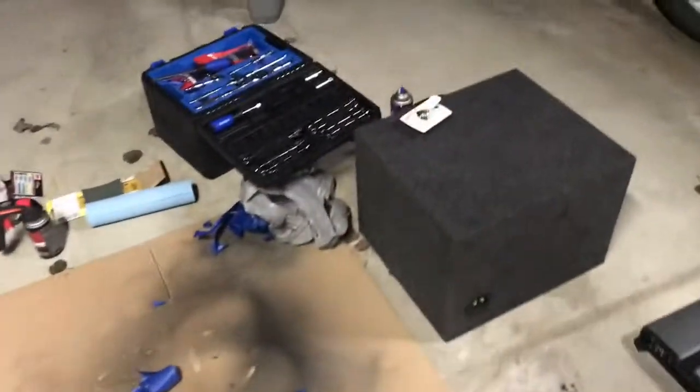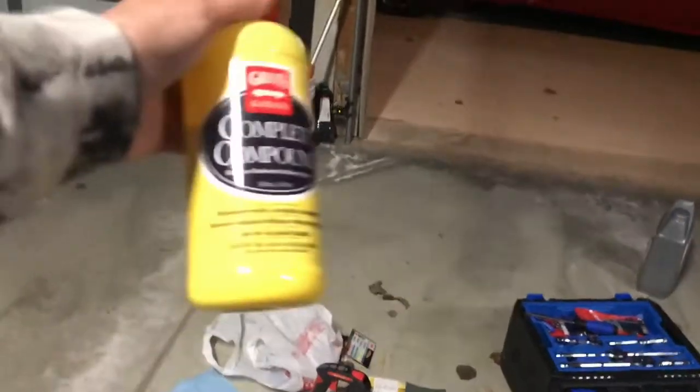But yeah, so I mean, that's the end of it. Pretty much what we did was we wet sanded the lights down with the 1500 grit, and then 3 coats of VHT. This handle really helps. And after the 3 coats of VHT, we also did 2 medium coats with clear coat, the automotive clear coat, and then 1 really heavy coat on there. And then we used 2000 grit, sanded it down. It was a little dull. And then we used this compound with the wheel. You don't need a wheel, but it makes it a lot faster to clean it up. So yeah, that's about it.